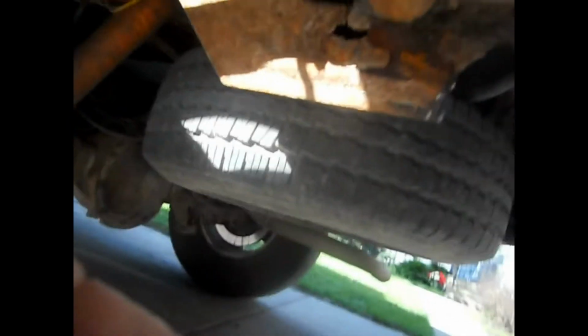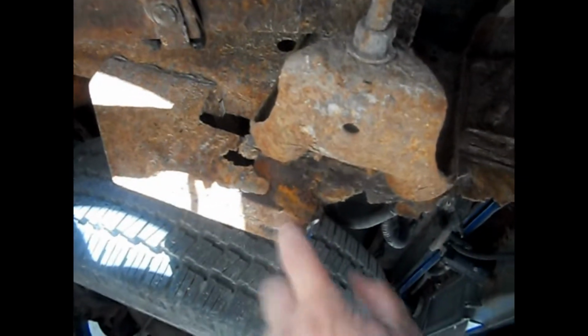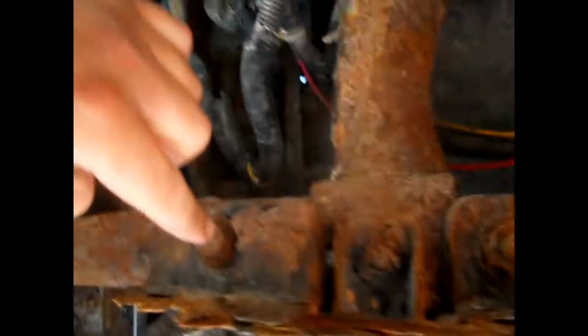We're underneath the truck so you can see what I'm doing here. And take the torch and cut the bolt heads off to remove this bracket, because this is the old bracket. You see how rusty it is underneath here? So tomorrow morning I'm gonna go over there and right there's 1, 2, 3. This bolt I might have to save, I don't know yet. Those 3 bolts gotta get removed, the bracket falls off, and then I can bolt a new receiver hitch on, which lays right over there, right by that Mr. Snowman right there.